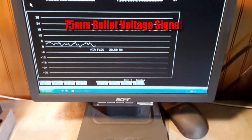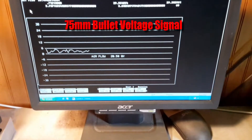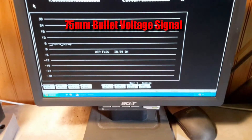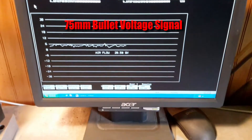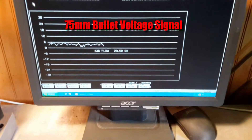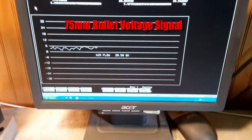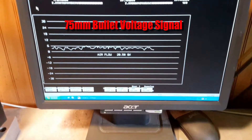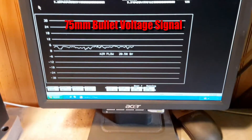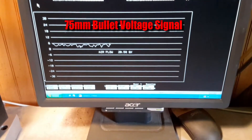Is this the cheapest in terms of quality, or is the bullet the worst? It's the cheapest. From a design standpoint, the sensor itself is packaged differently but the electronics are the same. The way it works is the same, the way it handles reversion is the same — there's really no significant difference between the two designs, and there's really not much difference in the quality of the signal either, as you can see. This has a tonsil style mass air meter in it. I would say the quality of that signal is slightly better than the slot.